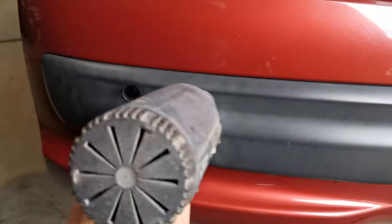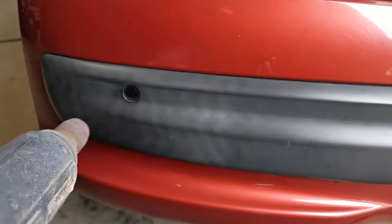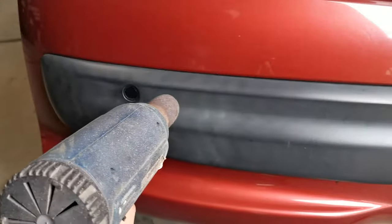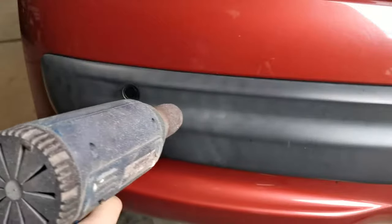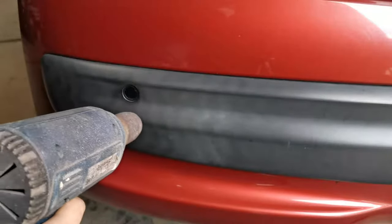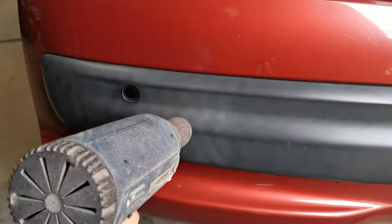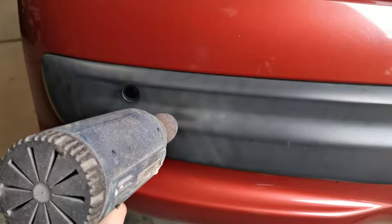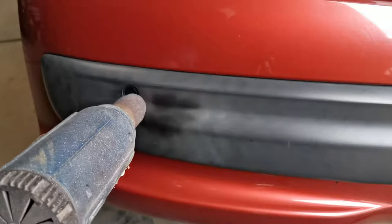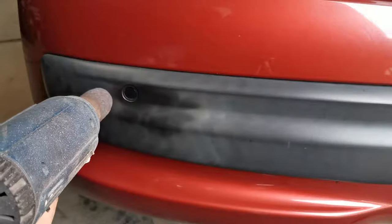Basically what I'm going to be doing is using heat to restore the black bumper. For this to work, I first start by gently heating the bumper before progressively working outwards from a single central spot. You can see as I start to focus on a small area the bumper slowly changes from grey to black. Once this spot starts changing I work outwards from there and as I do the colour begins to spread.